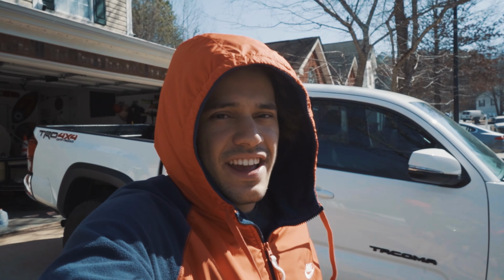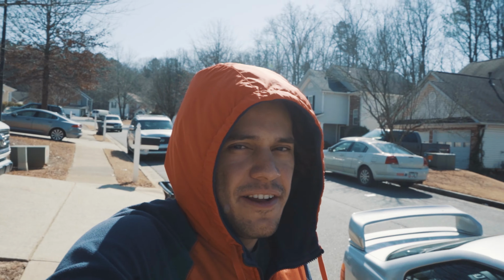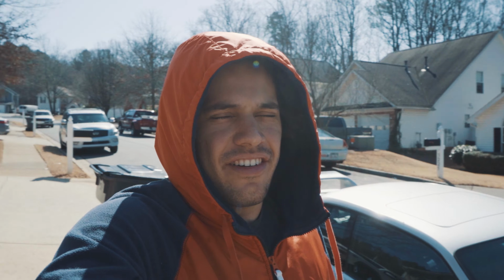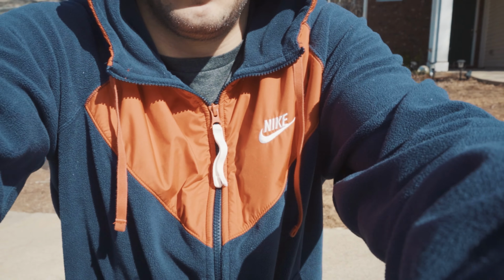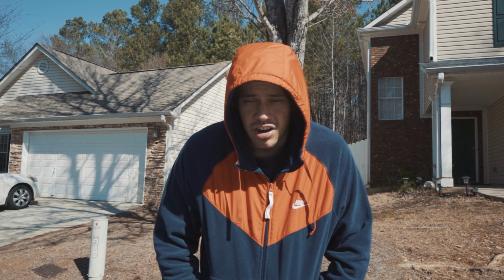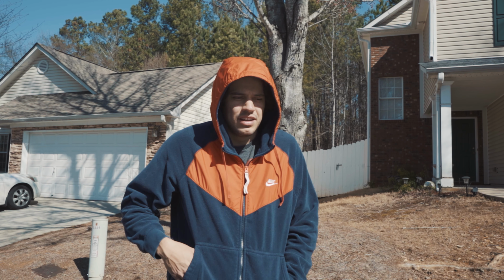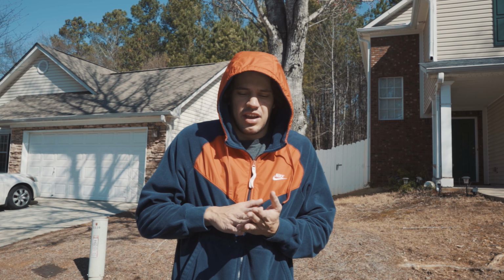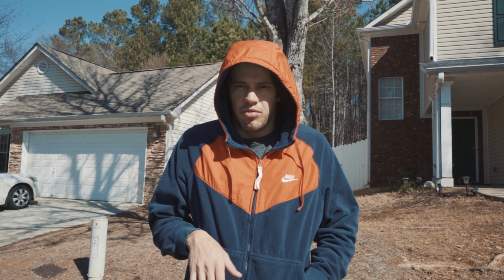So yesterday it got dark, so I just stopped filming and I was just gonna pick it up today. I was gonna let you guys know exactly how everything went, and it did not go good. So I just went for a test drive. Well, it's not that bad. I went for a test drive and the car started actually overheating. It's because there was air in the system, and all that you really need to do is go for a test drive and keep coolant and water in your car.